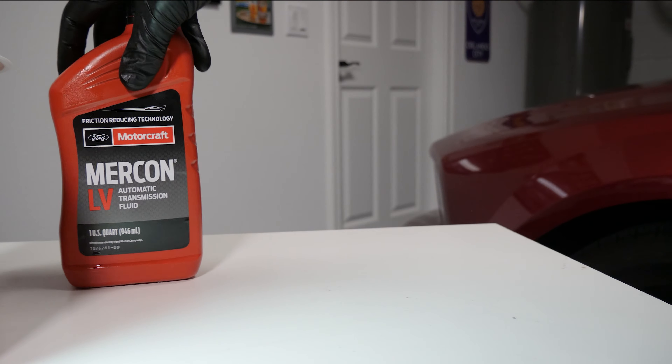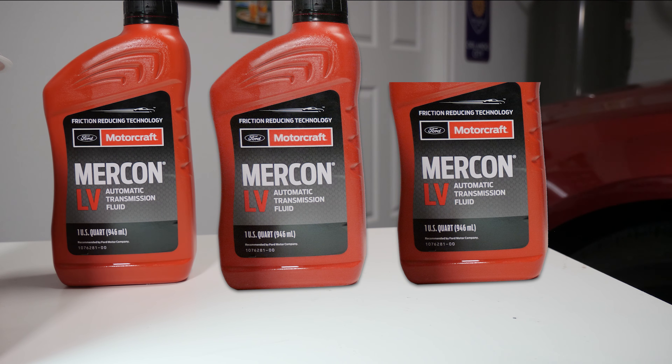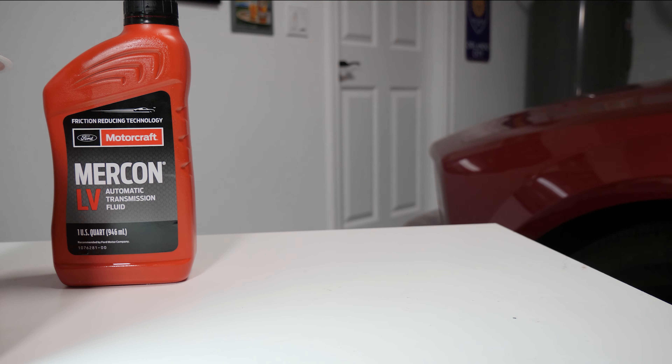The craziest part is that when I emptied the pan, I got less than three quarts back out of it — short by at least a quarter to half a quart. When your transmission has low fluid or really old fluid, there can be a lot of symptoms, anything from just being noisy all the way to not being able to shift into gears. That's actually what my problem was — while driving, I had issues getting into first, second, and sometimes reverse. This was only when the car was running and I was at a complete stop, so I knew my synchros were not a problem. After seeing this fluid, I would just about guarantee this is going to help, if not fix my problem.